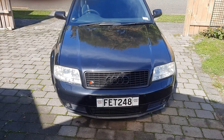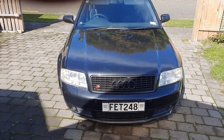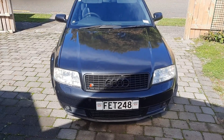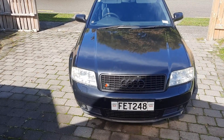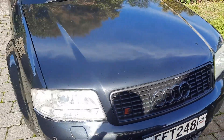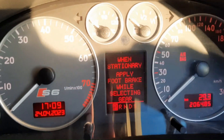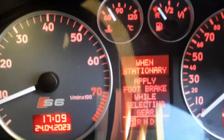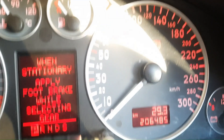The S6 has got an error code coming up with a flashing brake light symbol and traction control sometimes as well. Managed to track it down, put the VCDS on and got no communications with the ABS module. The brake error code has been coming and going for a while. This is what happens when you start the car — it comes on, three beeps, and the flashing park brake light. The park brake is not on at the moment.